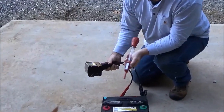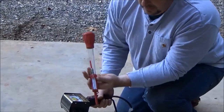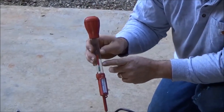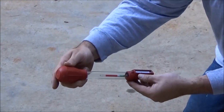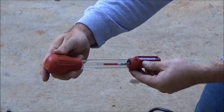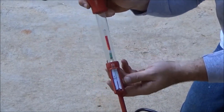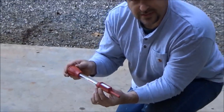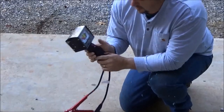There are three simple troubleshooting tools: a voltmeter to test whether the battery is charged, a hydrometer which tests the specific gravity of the battery's contents — I like this one because it's temperature compensated — and on a cool morning like this it's telling me to subtract 14 from the reading on the actual float. It's a temperature-compensated battery checker testing specific gravity, which is a great test but might not be sufficient on its own.